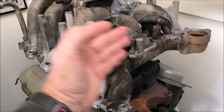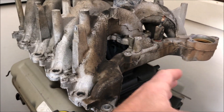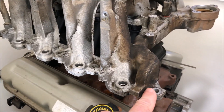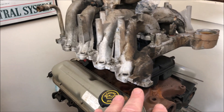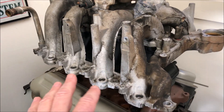You'll also have to remove the alternator to get this intake out, because that big plastic section is blocked by the alternator. And make sure you grab all the bolts that bolt this to the head — there are 10 of them, and they're a different length than the bolts from the stock plastic intake manifold. Having those ready will definitely help the install and save you a trip to the hardware store.